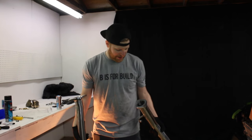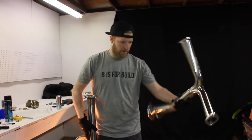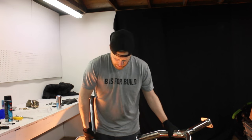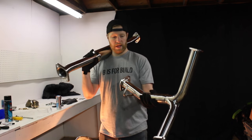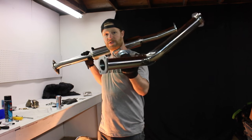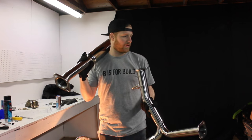We are back for the second day of this exhaust project. Off camera I re-bolted a new transmission mount - I didn't film it because it's not that interesting. It's eight bolts; if your exhaust is off it's super easy. Use a jack to hold your transmission in place, undo the eight bolts, and redo them. The next step is finally getting to our Zeta exhaust - the Nameless Performance overpipe and front pipe are on. So this connects up to that, then runs back along the car. I'm going to go ahead and try to mount these two pieces first and once I get them mounted up, I'll bring them down there for you guys to see.